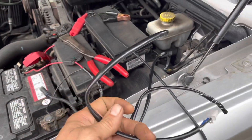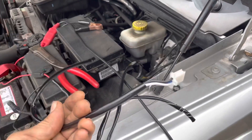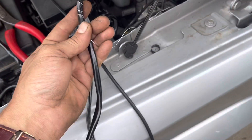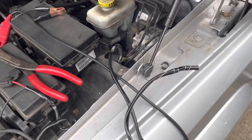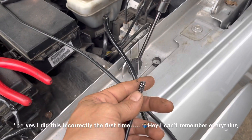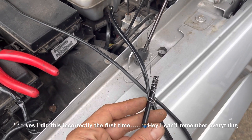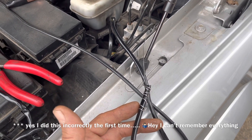Once we've left enough space to connect the connector, we go ahead and affix our wire to the end of it and pull it back down through. When using this wire, make sure it comes out at the tip — if it's down at the end it's not going to pull the wire through. And that works great — now we've got plenty of wire to make our connection.